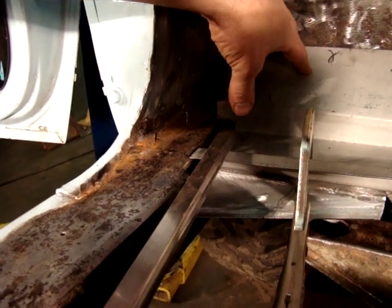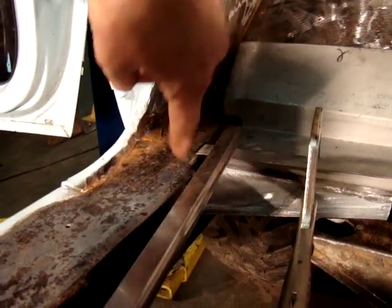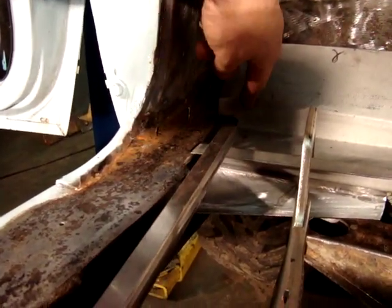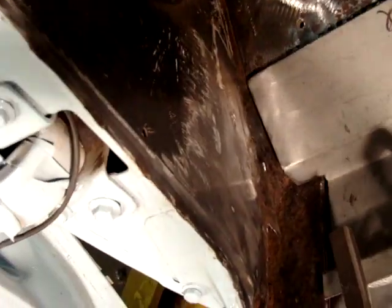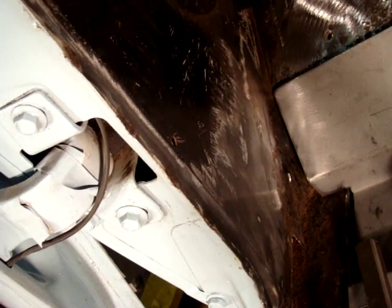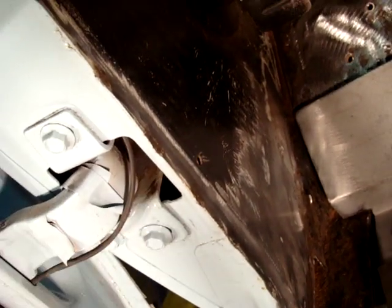A lot of people do it the opposite way. They put the body mount in and then they mount the wedge. Then you won't be able to get the top weld sealed. We're also going to fill this whole gap in with weld, so it all seals, and then we'll probably use some kind of putty. Ultimately, the whole vehicle is going to be Rhino Lined on the inside, so it's going to be completely sealed with a couple of holes in the back where the stock locations are, so we can park it on a hill, hose it out, and have a nice clean Scout.